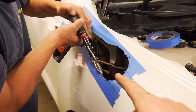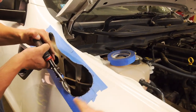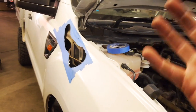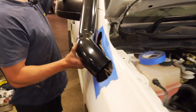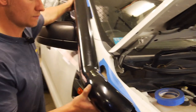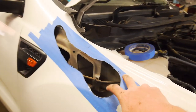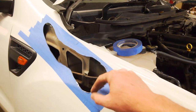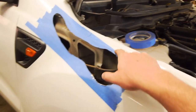For those of you who don't know tin snips, there are different colours for a reason. The reds are basically the off-cut on the left, the greens are off-cut on the right, and yellow is straight. Obviously this stencil is basically a bare minimum cut to get you started. Because we use a 92mm hole saw, that's about 10mm under 4-inch, so what we do is elongate this whole circle area.